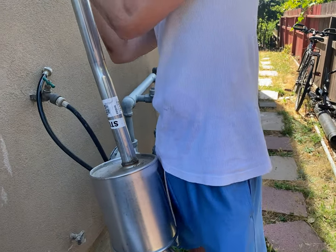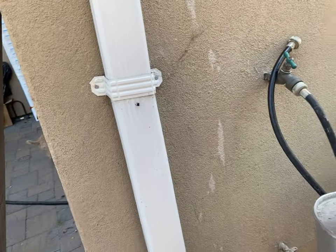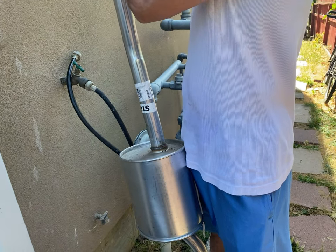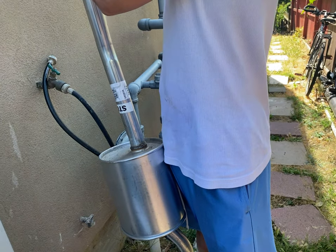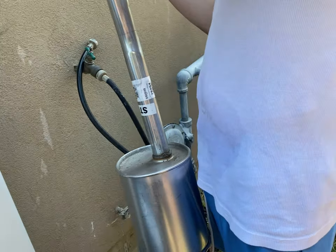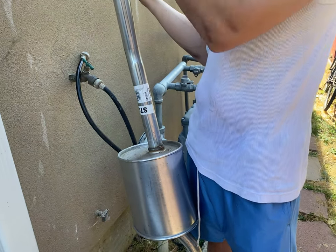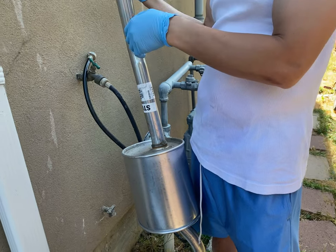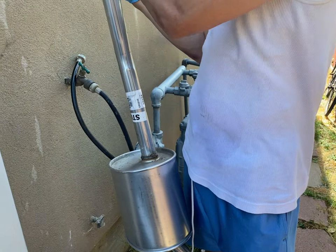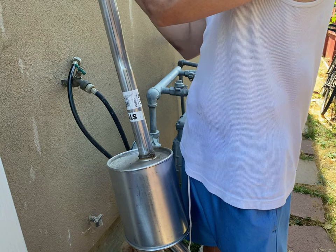We're dropping the whole exhaust to the ground again, taking the whole thing down, because you get better articulation and a better seal. You have to clean the inside because you can't have contaminants in there. This is galvanized coated steel or aluminized — I have no idea which. Clean the inside, clean the outside so I can weld. Especially the old one because it has carbon in there — there's no bond if you have a bunch of carbon.